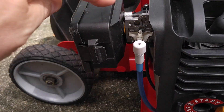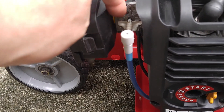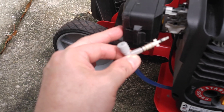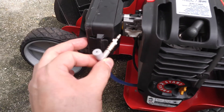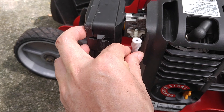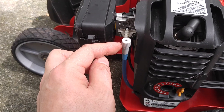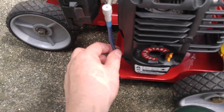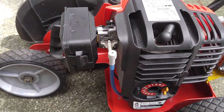This is the regular carburetor that came with this thing. I took off all the fuel parts and used a plastic hose barb — one eighth inch hose barb with an o-ring — so it would feed the propane directly into the venturi of the carburetor. This part right here is an aquarium inline air control valve, and this is aquarium tubing too. I chose the 3/16 aquarium tubing because it's easily available and very inexpensive.